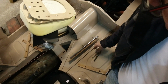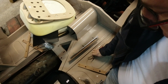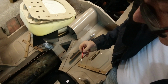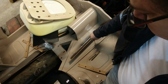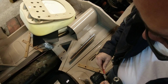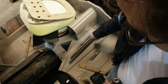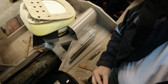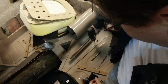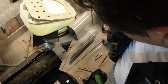I don't have one of those fancy step drill things, but I'm going to drill these holes 3 sizes. Start with the smallest, give it a location, and move up. This is a center punch. Basically put it on the spot. Sometimes it works. And it pokes a hole. Well, it dents it so your drill doesn't wander around. Alright, fits in the hole, that's a good thing.